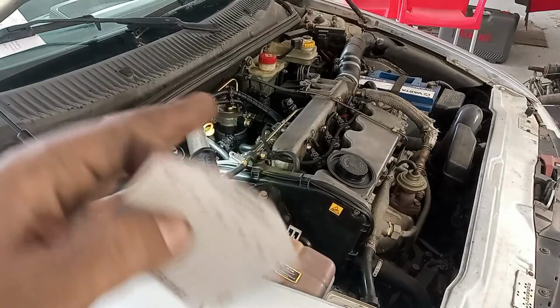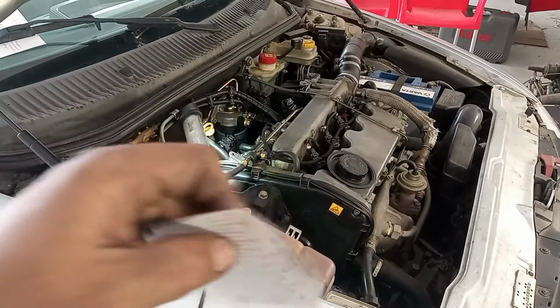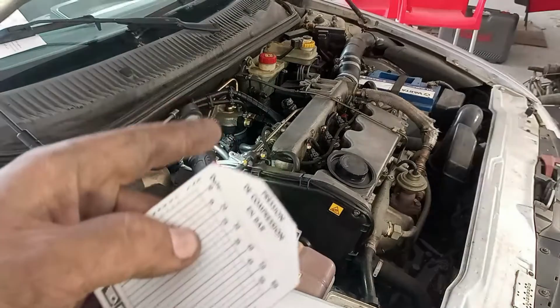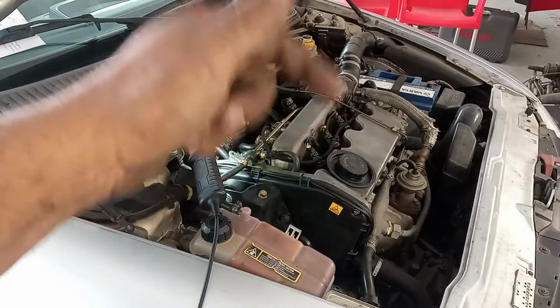Okay, so I'll try air first maybe. See the air filter, see everything, if everything is correct, see the EGR, testing the gasket over there to see if that causes a difference, and then I'll go to the fuel system. If you want videos for EGRs and how to test all of that, I have videos down in the description for that, okay?